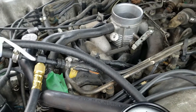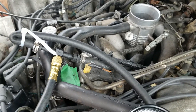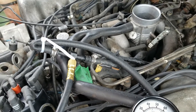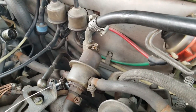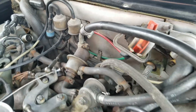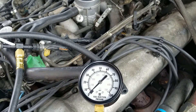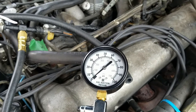All that needs to be done is that cold start valve needs to be replaced or repaired — for now it's just disconnected completely out of the system. Here is our fuel pressure regulator, and as you could see in the introduction video, it was bouncing around 40 psi and actually touching 50 psi during the initial test, which is way too high — almost double the pressure that's needed.